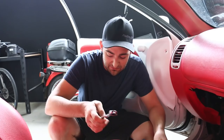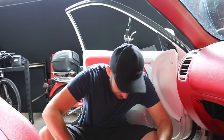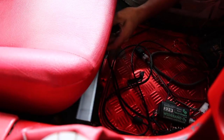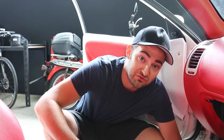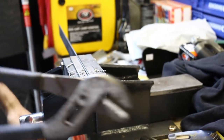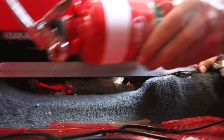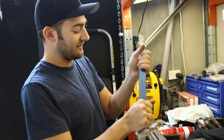I've drilled one hole in our bit of metal and I'm going to test fit it on here. Every car's a little bit different — you want to make sure the fire extinguisher doesn't get in the way of the seat sliding back and forth. In this car I'm going to have to bend it to go over the hump of the floor pan. You can use multi-grips and a vice to add any bends to make your bar fit perfectly. This is just to support the fire extinguisher, which is not that heavy, so you don't have to drill into your car.